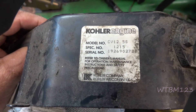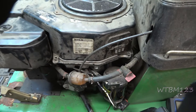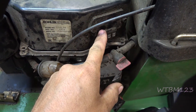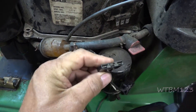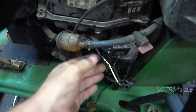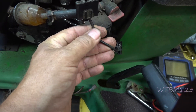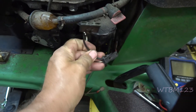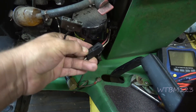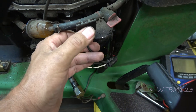The customer kept saying smoke was coming out of here. The stator is under there, and this is your voltage rectifier. The first thing I did was unplug it. When I unplugged it, I noticed these other wires — this is the positive lead that goes back, in most cases, to the key switch and then to the battery. That's what supplies voltage back to the battery.